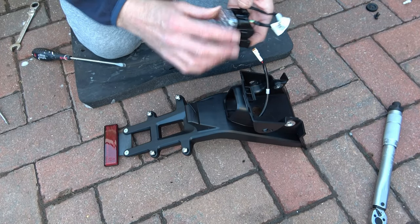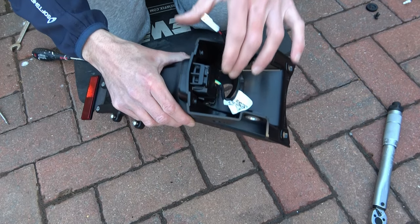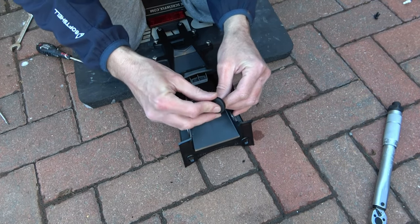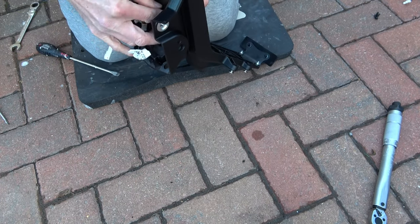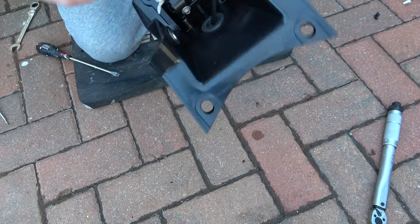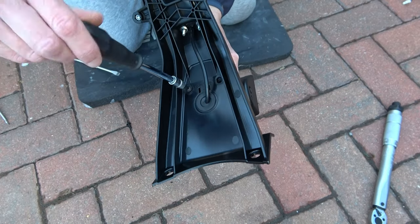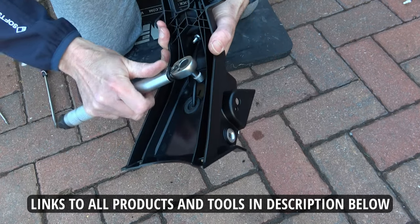So now it's time to refit all the parts to the new plate holder. Firstly take your light and just clip it back into place. Now feed the wire for your light back through the rubber grommet, then seat the rubber grommet firmly over the plastic on the plate holder — this needs to be done correctly as it will prevent ingress of water. Reusing the screws we just removed, tighten these back up into the light on the other side. These should be tightened to 2Nm — I do this using a torque wrench.